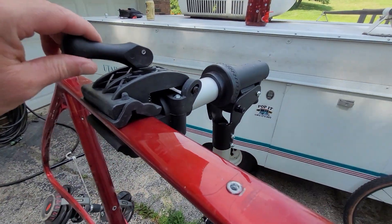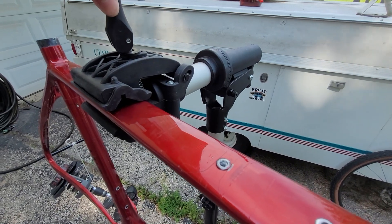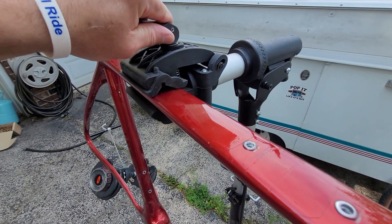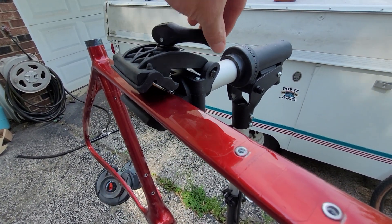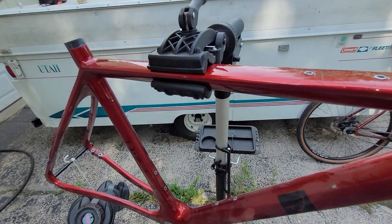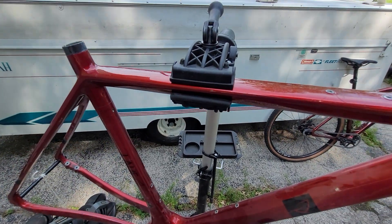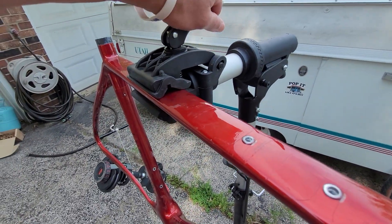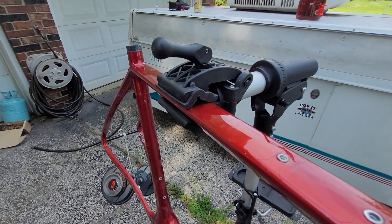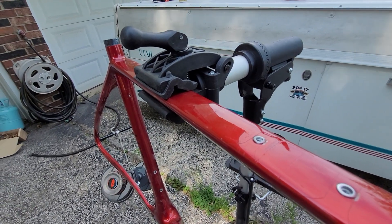So what I'm going to do is open it up one full turn, clam down — I have no idea how much force is on there in newton meters or anything, but I'm going to go a half turn and squish. That took a lot of force to close. If at that point you are still cranking on your bike, you are out of your mind. Let's open it a half turn — god dang, that is tight again. If you have destroyed a top tube on your carbon bike with that, you're Simple Jack.